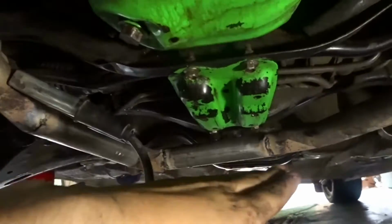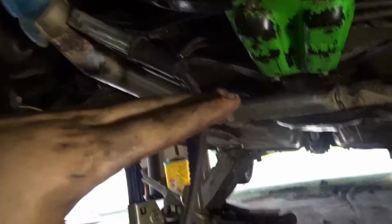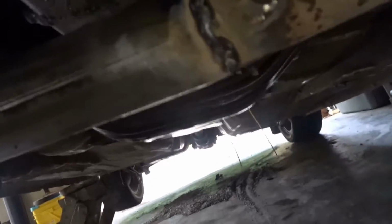So I got my welder hooked up underneath my car, and I used a jack stand to hold everything up, and here's the pipes. Here's my up-pipe. See, I pointed it up so it stays up off the ground, because whenever I made my straight pipe last time, that was completely trash, I welded it too far down, so my exhaust stuck too far down. But as you can see, those are just my tack welds. That one's really bad, but I got everything tacked in place.